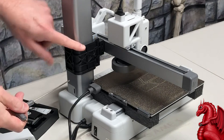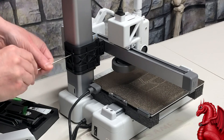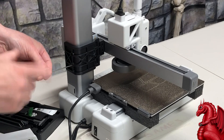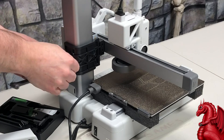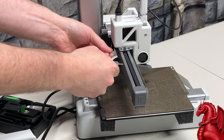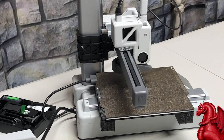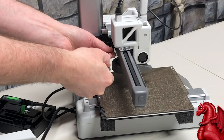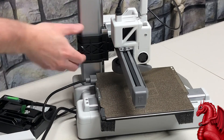To begin with, this black piece here is only in place for shipping. It's got four screws on it — you'll need to remove those four screws before proceeding. They give you all the tools necessary in the toolkit, including two hex keys and a little starter oil. Note that I have a separate lubrication video linked at the end of this video and in the description, because you will need to lubricate this printer before using it. You're going to take out these four screws — it's a bracket holding the Z-axis and X-axis in place while shipping.